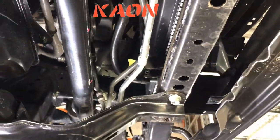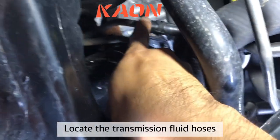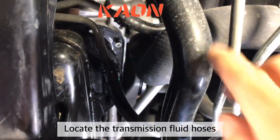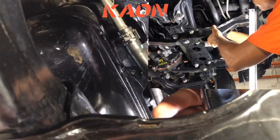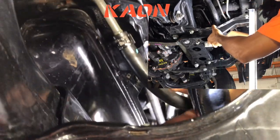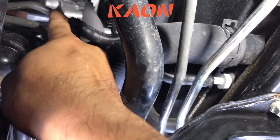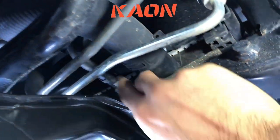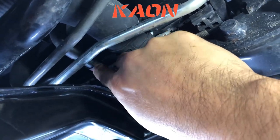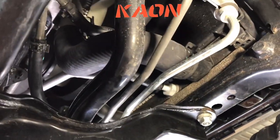We need to take the front bash plate off and you'll see the transmission lines — these are the two metal ones. They go into the bottom of the radiator. We've figured out that the top one, the one with the short bit of hose, is actually the return, and the other is the input — the incoming fluid into the radiator. What we need to do is plumb the auxiliary cooler into this line. One end of the cooler will go into the metal hose here, we'll get rid of this hose altogether, and plumb the other end to the radiator. That will position the cooler after the radiator heater cooler.